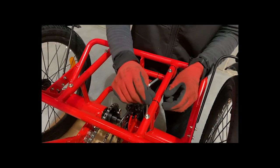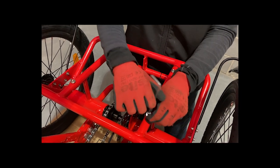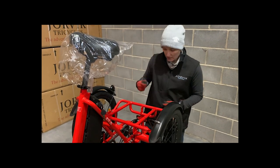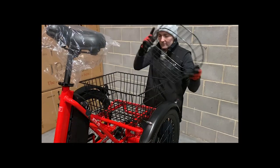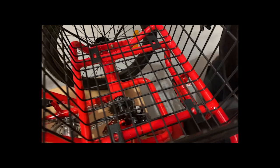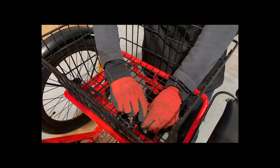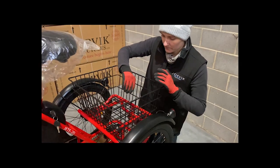Keep hold of your four — this is a good chance to take off these rear basket bolts. So just put it in, twist, and once you've removed all these, pop them safely underneath the axle. They're quite long because this is what's going to keep the rear basket mounted — pop them underneath and that means we're ready to put the rear basket on. To put the rear basket on, disconnect the cable ties that hold the front basket in, give them a snip. Then placing the rear basket on the back axle, line up the holes with the bolt entries. Grab the bolts you took out a moment ago, hand tighten them in — they'll go quite far just by twisting, so you'll save a lot of time. Give them the last few turns with the number four, and that is your rear basket on.